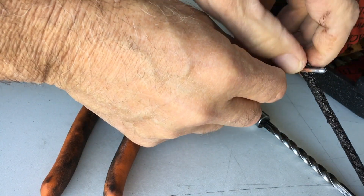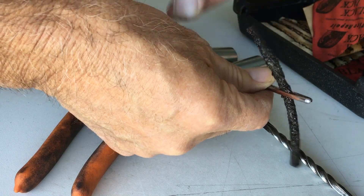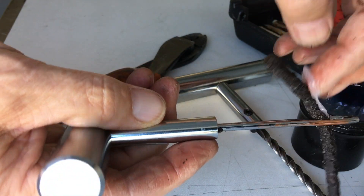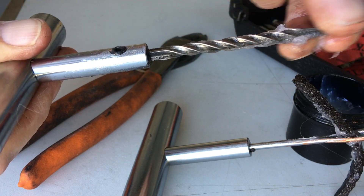Slide the plug into the plug installer — it should be even on both sides. Now add a generous amount of lube to the plug; this will help it insert easier into the tire. Next add some lube to the reamer and you're ready.